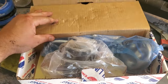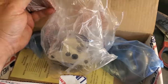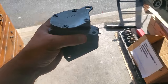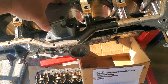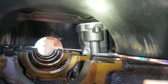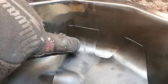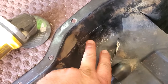Here is our new oil pump — this is a Melling, I'll leave the link in the description below. This is supposed to be higher flow than stock and is recommended for the Jeep, but I know there's controversy on the fitment. We'll reference our XJ motor that I have pulled for Beach Jeep. We are very lucky we have an engine outside the Jeep, and you can see it is making contact right there on that little baffle. I'm going to go ahead and cut a groove out of the baffle to make some room. I cut the baffle with my angle grinder, snipped this with my tin snips, then torch-heated and hammered it to give a little clearance.